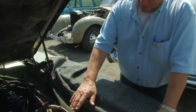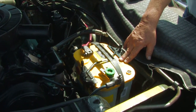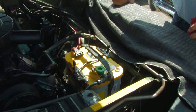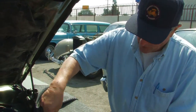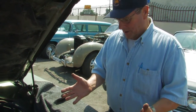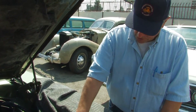I want to talk to you about a different type of battery. This is an Optima battery, and this battery uses spiral cell technology. If you actually look at the sides of the case, it looks like a little six-pack. It has a number of different circles on it, and the cells, instead of being flat plates, are actually wound in a circle with a separator. It is still two dissimilar metals in the presence of an acid, but this is a sealed battery.